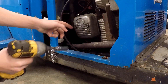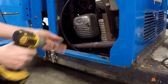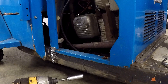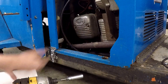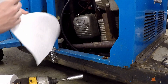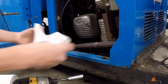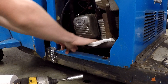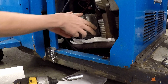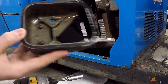We'll start off with taking off the old two nuts to hold the valve cover on. Before we take this off, we're going to get some paper towels. Make sure you get all of this underneath the valve cover — fill the paper towels, because this will have a lot of oil in it. It's good if you let the oil drain back into the engine before you do this. Just pull this off quickly and tip it up so the oil doesn't leak everywhere.